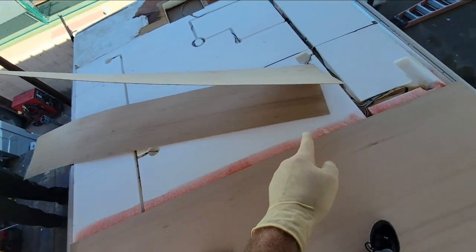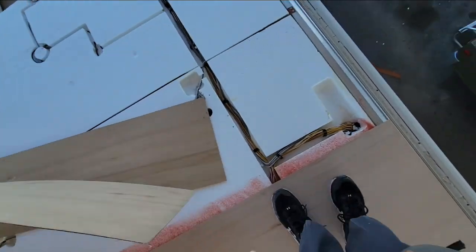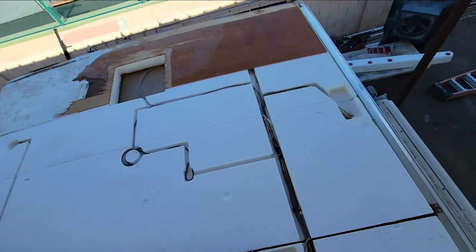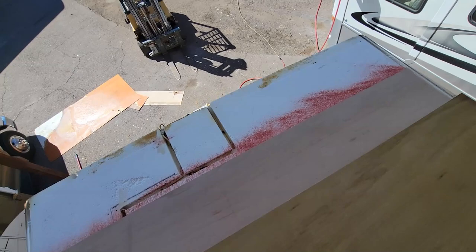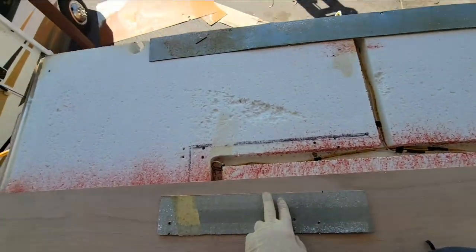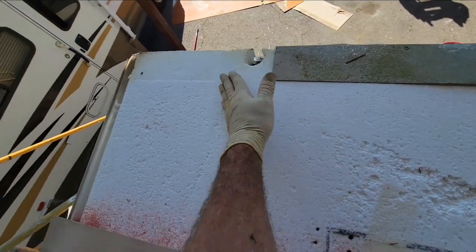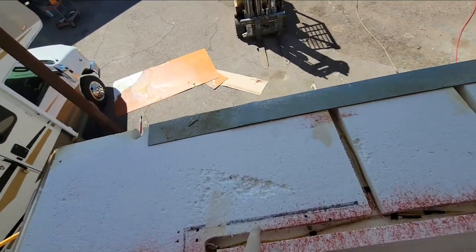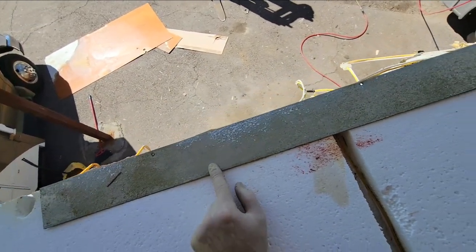Yeah, so we just had two cut pieces go from there to there so the next seam doesn't land on the seam of the styrofoam. And then one more back here. I do have to put the metal underneath there. So this is the metal that came off. Winnebago uses that underneath the Luan, and then you have screws that can hold on to a piece of metal. This is a pretty thick gauge galvanized steel.